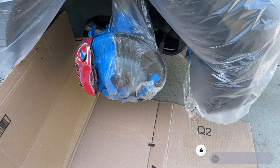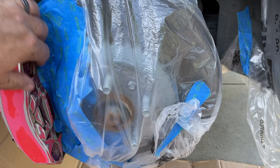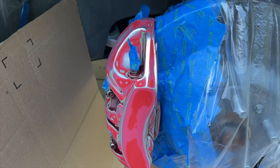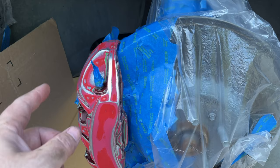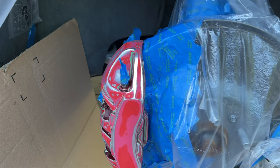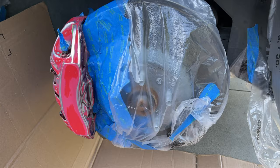This one is all sanded, washed, taped, and plastic put up. Make sure you get your tape slid up underneath the edges. Don't be afraid to use a lot of tape and a lot of plastic to cover everything. In places with a rubber cap, I put a piece of tape around it and press it flat on top — so once I'm done painting I can just grab it like a tab and pull it right up, pops right off. No trying to pick around anything, just pulls off. Before I do each one I'll make sure it's wiped clean again and get some primer on it.